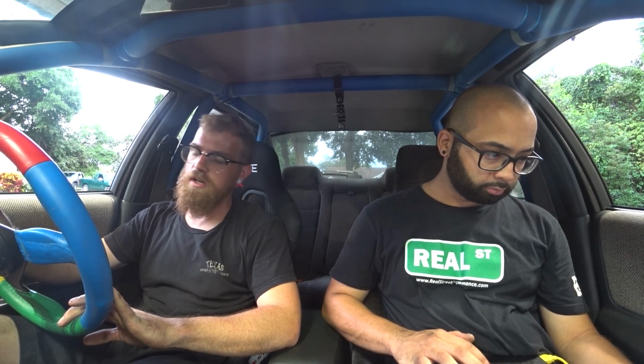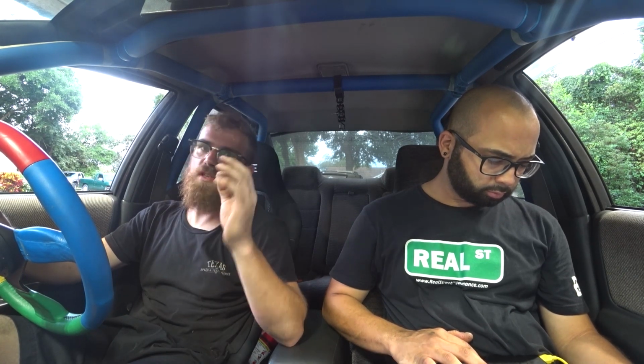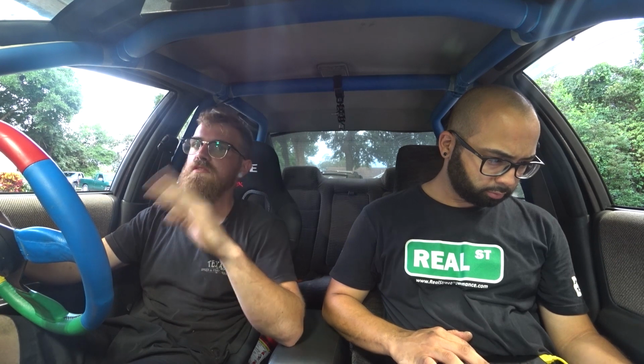All right guys, well, we're going to have to sort this out another time. We've done everything in our power. We'll figure it out, I'm sure we will, but for right now we're kind of stumped. I've got to get a new VTEC solenoid, or VTC solenoid, to see if that fixes the cam control issue. If that fixes that, then our issues are vibration and the crank signal cutting out at 5200 RPM. Fingers crossed. If you guys have any ideas, let me know.